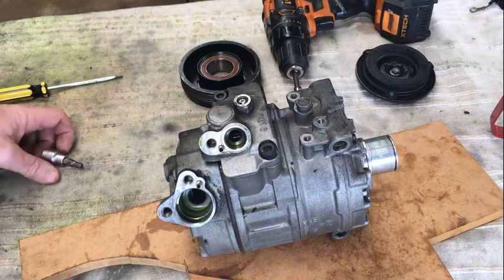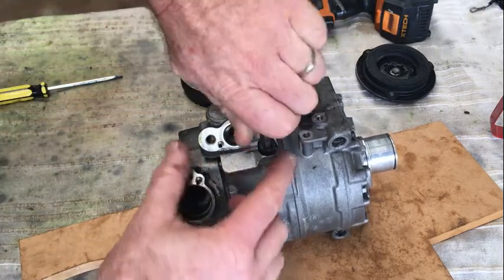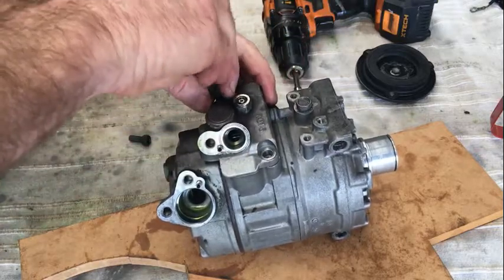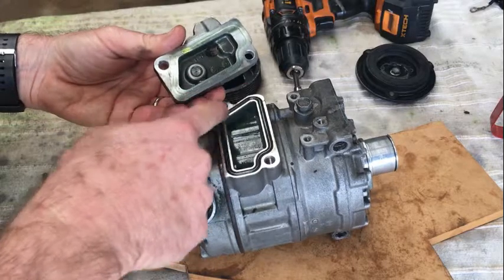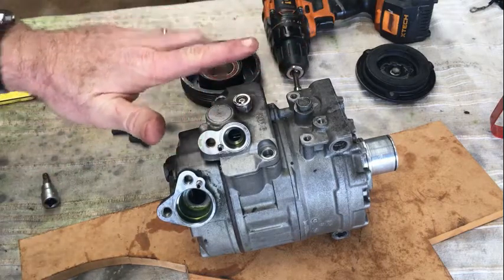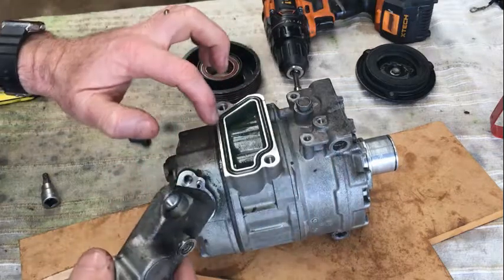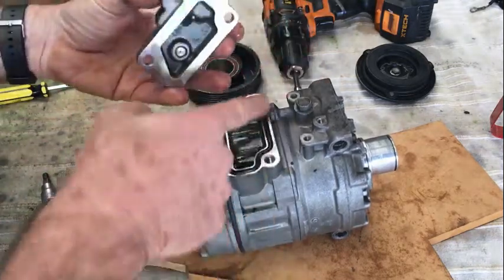At the top of the compressor you've got the high pressure outlet and the low pressure inlet. There's a cap that sits on the high pressure outlet side which has two Allen key bolts. When I pull that off, you can see there's a big seal around here — I think this is actually what's failed, because on the casing next to the engine you could see it had sprayed dye, which is the green stuff inside the oil, showing that's where it was leaking. I'm assuming it's just from this seal — the car's nearly 20 years old, so it has failed over time. Once you pull that off it's pretty easy to replace the seal.